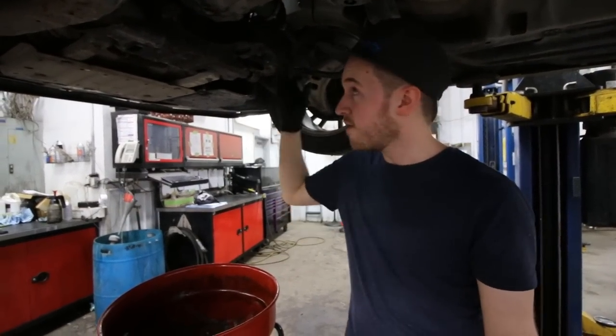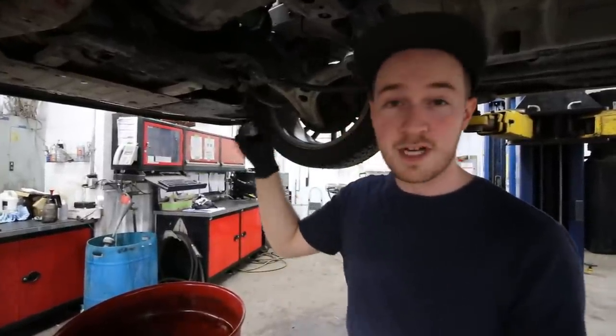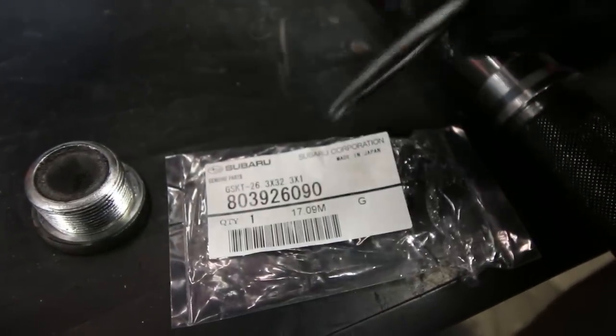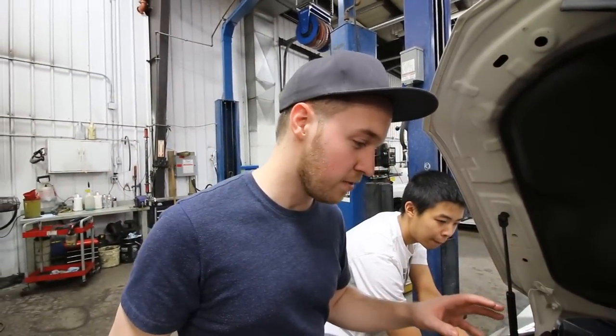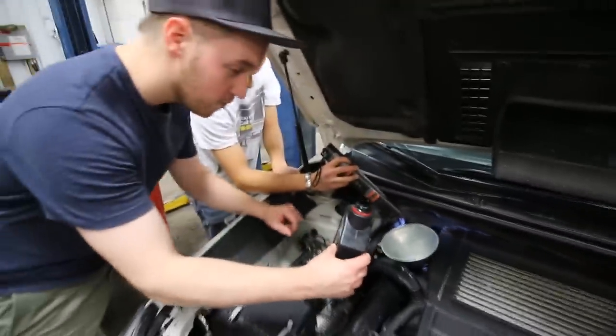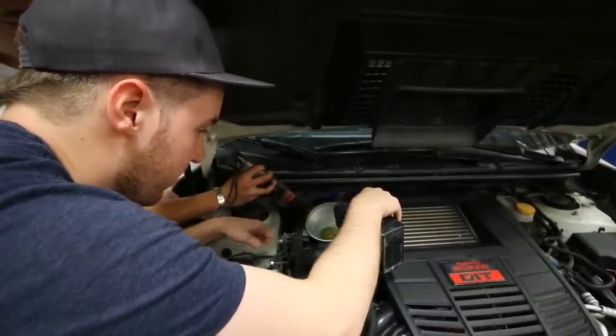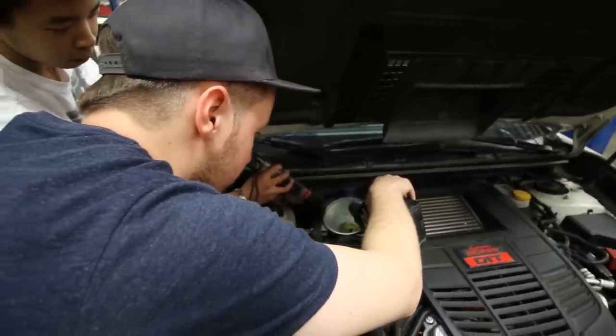Once the front transmission has stopped dripping and all the fluid has come out, we can put that back into place. Don't forget to put a new washer or gasket onto the drain plug bolt before putting it back. Instead of using the pump for the front transmission, we actually found it easier to just use a funnel with a flexible tube on the end to get it into the fill hole, which is on top of the transmission but underneath here. We've got it lined up and now we're just going to pour the fluid in slowly — actually not that slow, considering we warmed it up. I had it in the garage for the past three months, then last night I put it in the house where it's warmest.